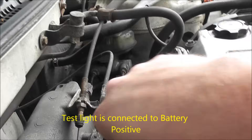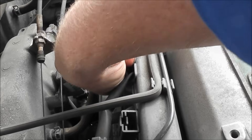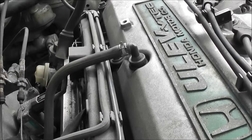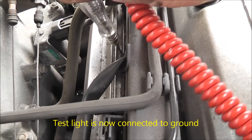There are other ways to do it too — we can leave it plugged in and back probe it, put a scope on it. We're just doing some quick tests here to find out what we're missing. We do want to check this injector for power as well. I have injection pulse, but let's make sure we have power to the injector.